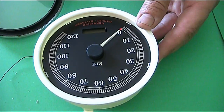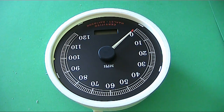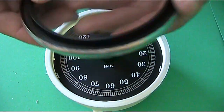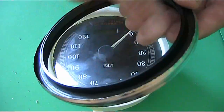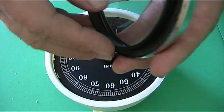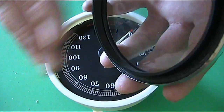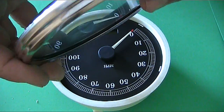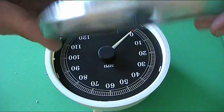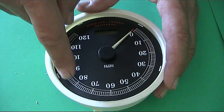The bezel will pop right out and now we've got our speedometer open. We've got our speedo glass off. If the only problem is that your glass has broken, just pop this rigid plastic seal out, being careful not to cut yourself on broken glass. Take it apart, put in the new glass, put the black plastic seal back on again, re-close it, and continue with the end of this tutorial.